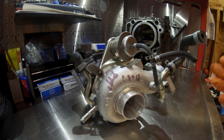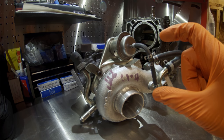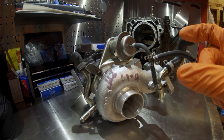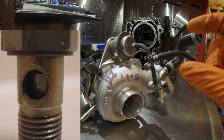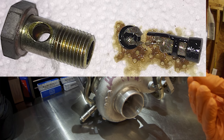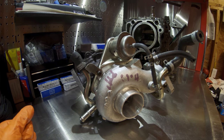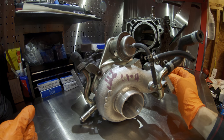There are several causes to why the turbo fails on the EJ255 engine. There is a banjo bolt that feeds oil from the engine to the turbocharger. The banjo bolt — Subaru calls it a union joint or a union bolt — has a fine mesh filter screen built in, and over time this filter screen clogs up. When it clogs up, it will starve your turbocharger of oil, and that is the main cause of the failure on the turbochargers — lack of oil to the turbo.